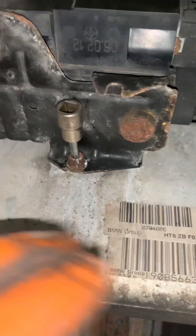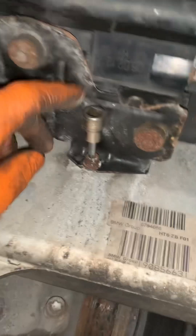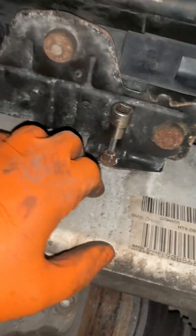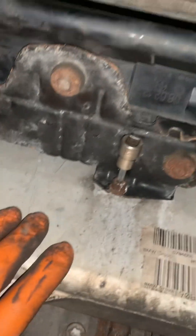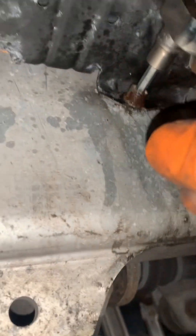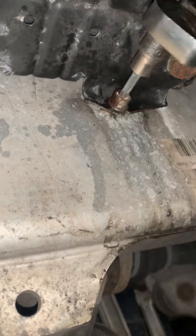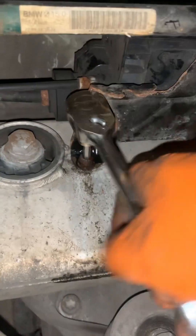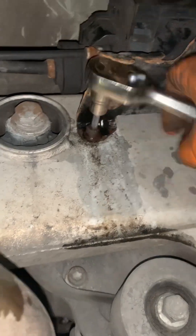Follow it past the diff and you get to the actual unit. There's one plug here which is nice and easy to remove, and then these are 6mm Allen keys. Apply plenty of lubricant because it's going into alloy and we all know how they like to fuse together and snap, so be very careful. Apply a lot of release lube - that was very pleasing. Here we go, lovely.